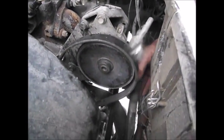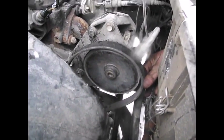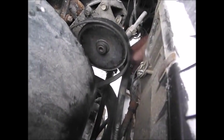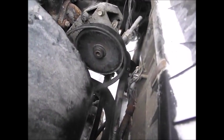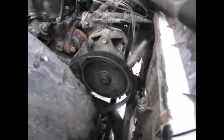This is why it has to be loosened up to get that movement. The belt was a little bit too big, and the new belt was a lot smaller than the belt that was on it, so in my case I really have to loosen this adjuster bolt up quite a bit — I need another inch to go. Not the easiest bolt to get to in the world, that's for sure, but slow and sure we'll get the job done. Thank you for watching everybody, and don't forget to subscribe.